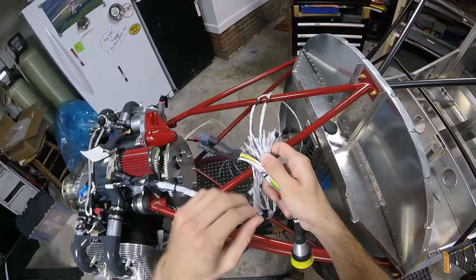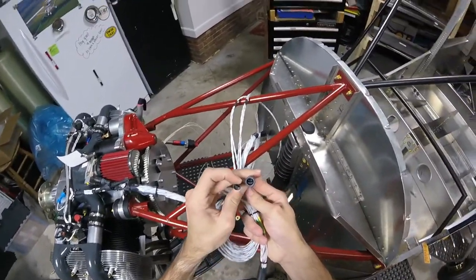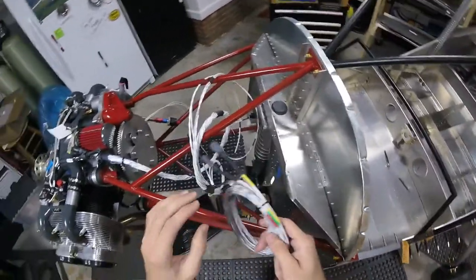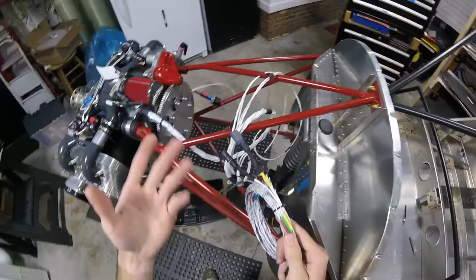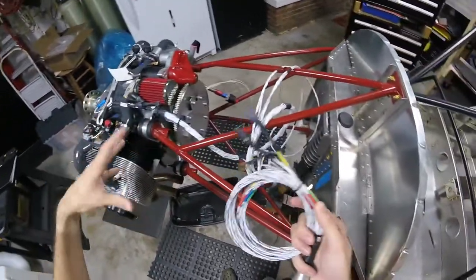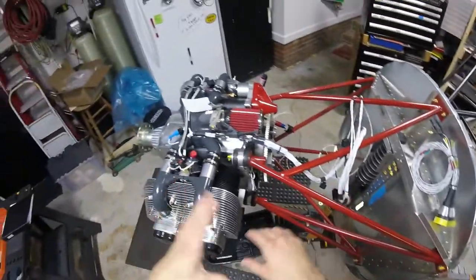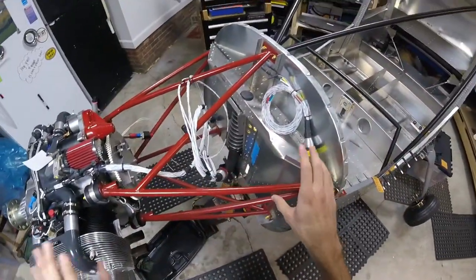Out of the ECU comes this thing with individual wires you can attach to stuff. One of these ports connects to the UL READ software (R-E-A-D) to diagnose your engine, and the other one connects to your EFIS to give you all the engine monitoring data going into the ECU. Again, it does not include cylinder head temperature, exhaust gas temperature, or any extra sensors not currently on the bundle. You can't really splice those in unless you get the aux box from UL Power. That's what's been driving me crazy the past week or two — just trying to figure all this stuff out. Very confusing.